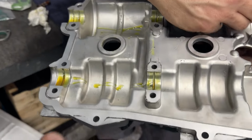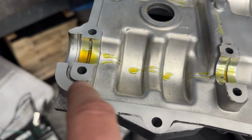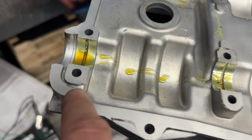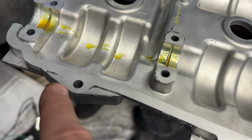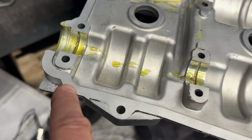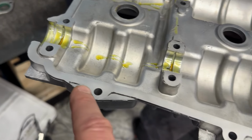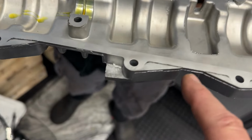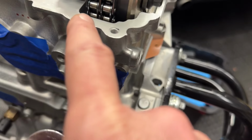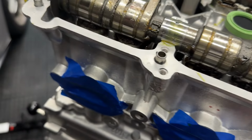All right, so we're going to be putting the sealant on here soon. It's very important not to get sealant in this here. I hear that if the green caps are popping off, that's because you probably have that passageway clogged. The pressure buildup fires them out. So we're going to make sure that all of this is super clean. We're going to take some Kimwipes and some cleaner to clean all of our surfaces really well, and the same with the mating surface here on the head.